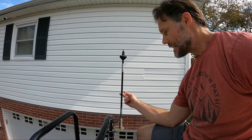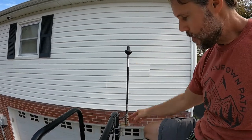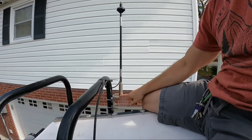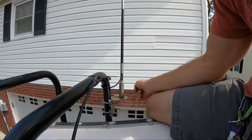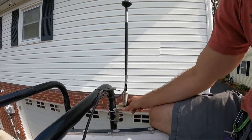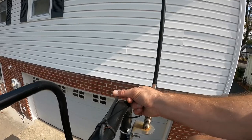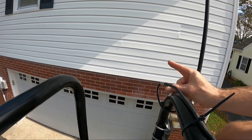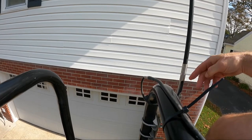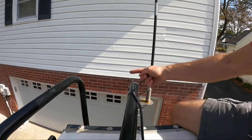All we're going to do is replace the mast and put the new antenna on top of the new mast. I'm also going to replace the spring because this one's a little rusty. The bracket itself is pretty substantial — it does not need to be replaced, it doesn't even need to be tightened, so it stays. The two come together at this point here, so I'm going to take this apart, take this off, and toss it. We'll start fresh from this point back.